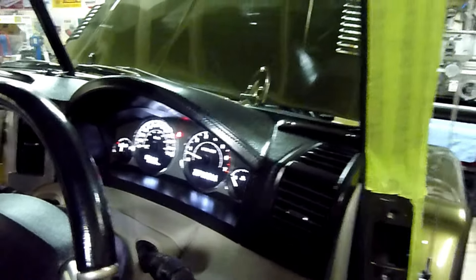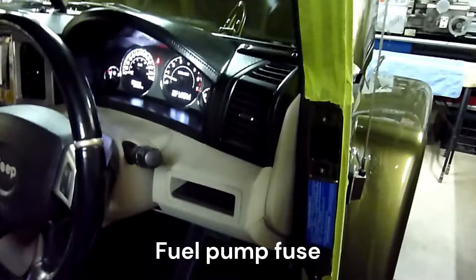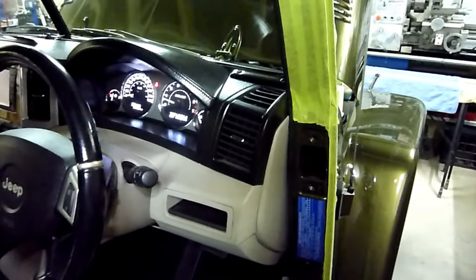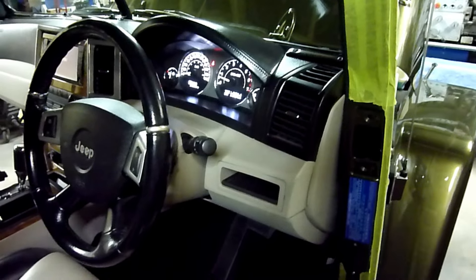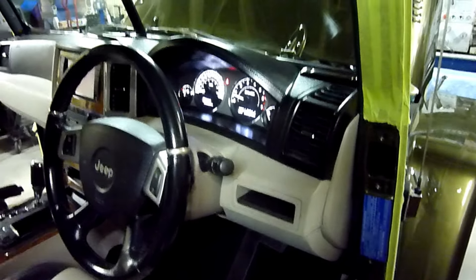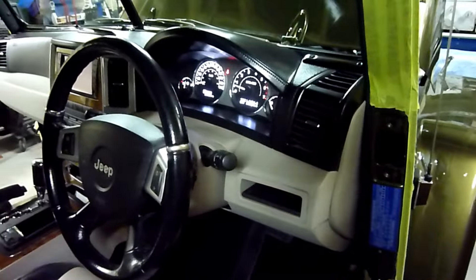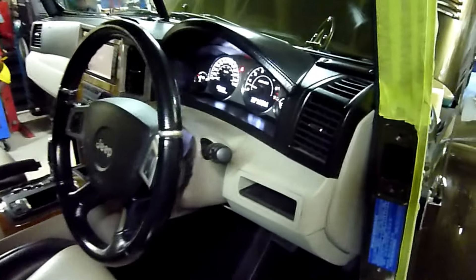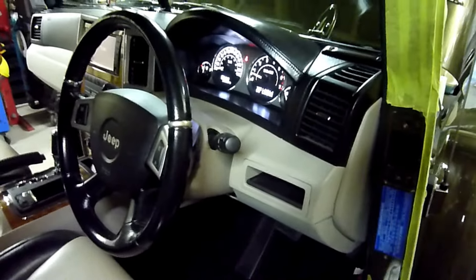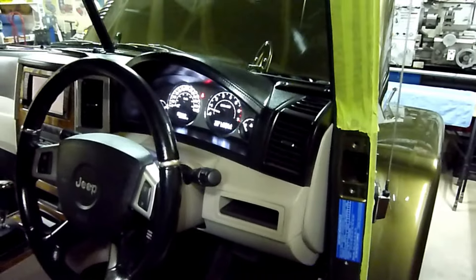I had actually pulled what was written as a fuel pump, and I thought I was going to turn it over for a little while first, but it just fired regardless. There must have been a difference between the diesels and the petrols. Unfortunately it still started - I wasn't planning that. I should have turned it over for a bit first to get some oil pressure up. Oh well, what's done is done. Fingers crossed.